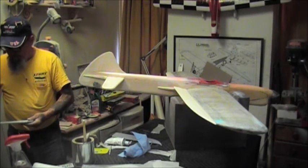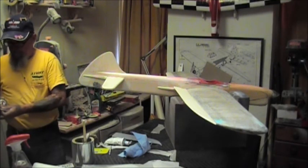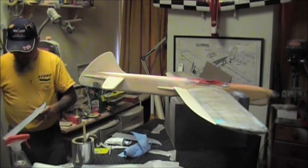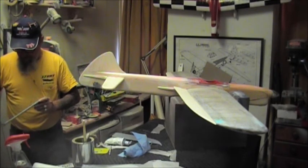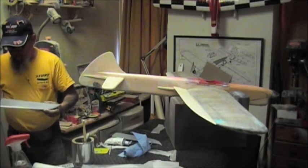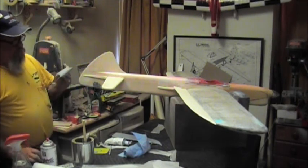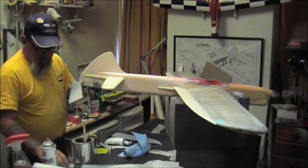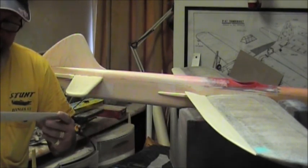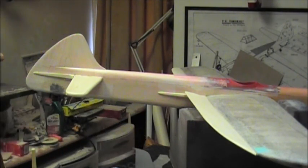We're not painting where it's already dark - we don't need to paint there, so we're just painting the light spots to make it all the same color. We're just trying not to add any weight. I've got to go get another case of DC 540 now that I think about it, in case they run out. This was not a wet coat over the whole thing - it was just a dust coat to make it all even colored. But that's it, ready for paint. So that's the story on DC 540. I'll post it up and see you in a short.